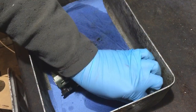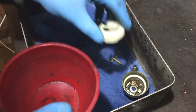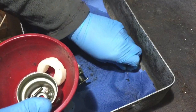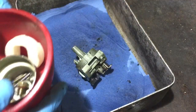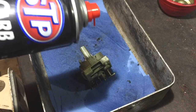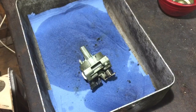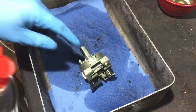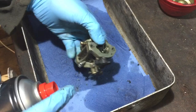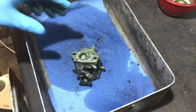I've got another little bowl to put all the little bits in so I keep them all separate — that way if you need to change the blue roll in the tin you won't accidentally throw anything away. Now, some people use WD-40 but I like this carb cleaner. It will expand rubber gaskets on some carbs, but on the Honda ones the gasket is right in there so it's not going to cause damage. You want safety glasses on because carb spray stings quite a lot when you get it in your eye.